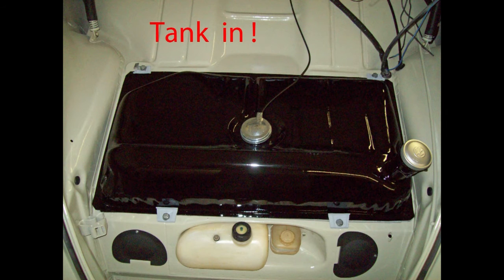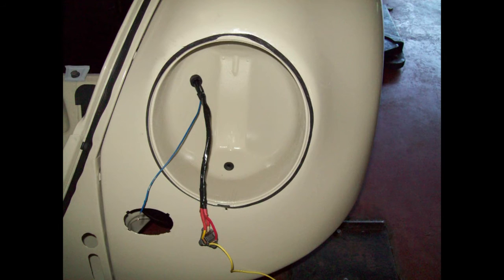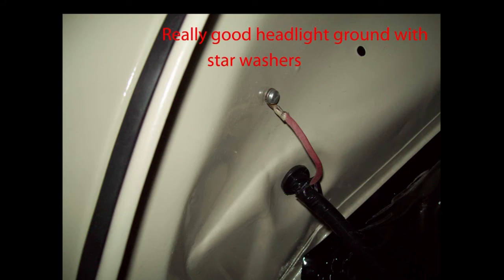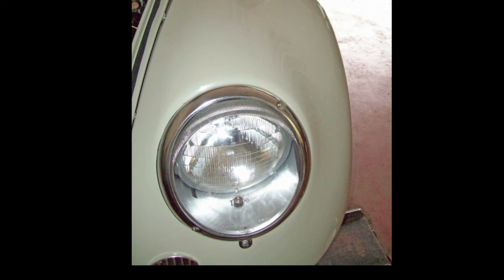When you get fuel in the tank and the weight increases, you'll have to go back around and tighten those four bolts. I was going to do the battery cutoff switch with a cable, then changed my mind. I wired the headlights, soldering and using shrink tubing. You won't regret making your grounds really solid — a star washer under the terminal ensures a good ground by biting into the metal. I'm leaving the fenders loose because I'm going to paint the fender beading and install that. I'm really happy with the way the headlights turned out.